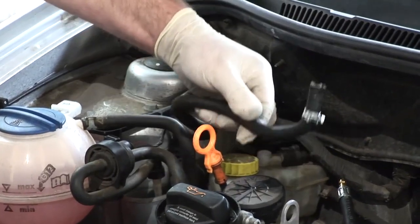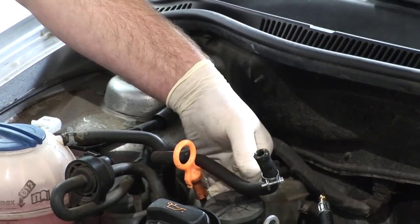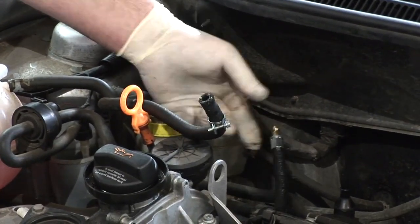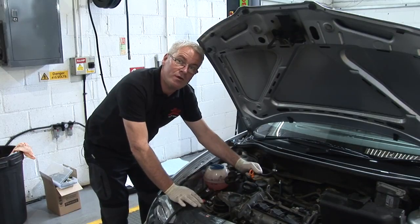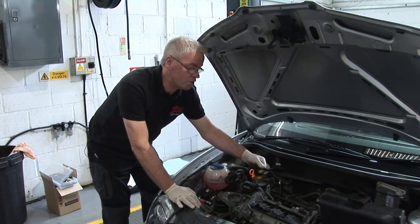It's really important to stress that once we've got the vehicle fuel supply disconnected, we are now running the vehicle on the ES3 supply — so the original fuel pump needs isolating, either by removing the relay, a fuse, or disconnecting the fuel pump. We must stop this from working.